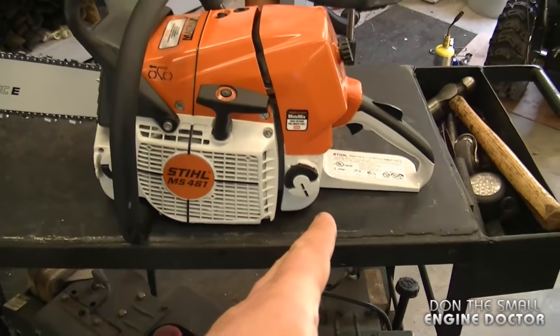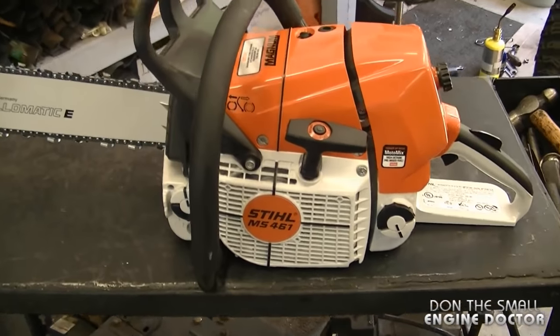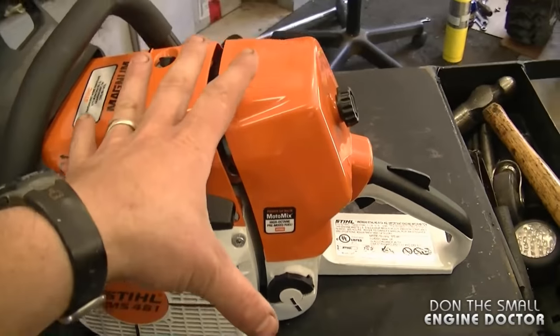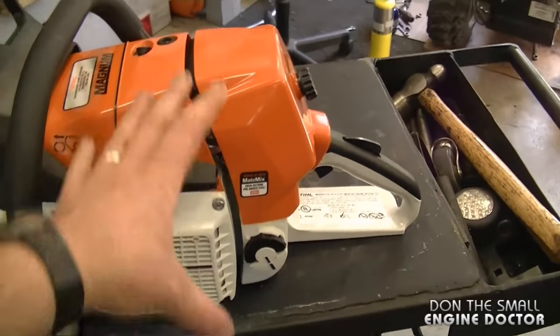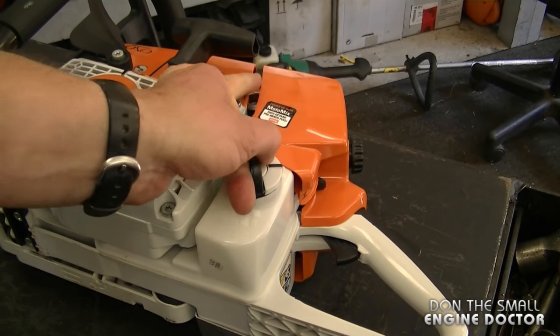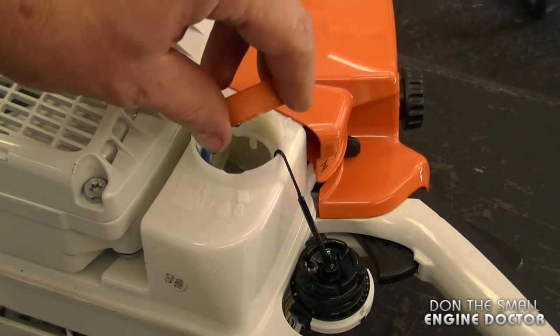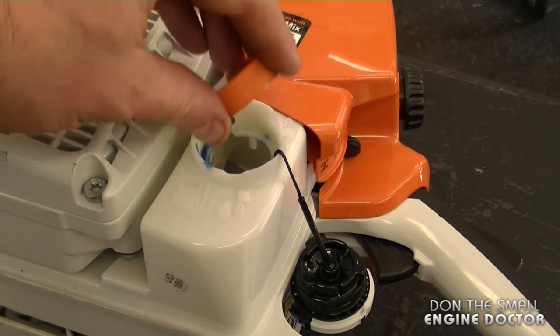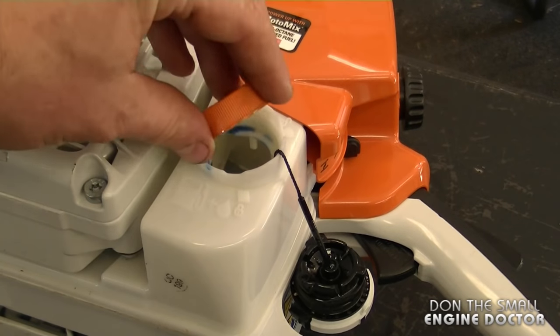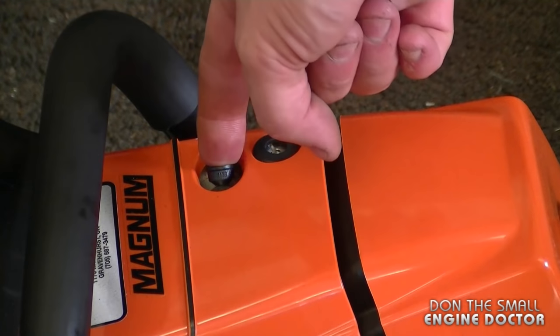This saw has been started once when you buy it, however I'm going to add a bit of oil in the fuel just for the first tank or two during break-in — I just want the saw to have a bit of extra oil in the fuel. It does have the toolless caps, so I'm just going to add a bit of oil and top up the fuel tank with fresh fuel. Then I'll start up the saw in the shop here — I'll make sure to use the decompression valve.